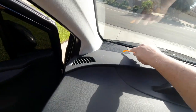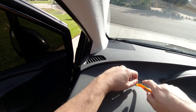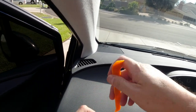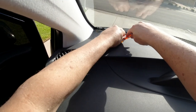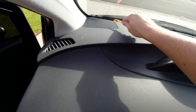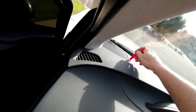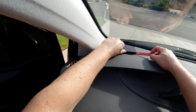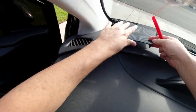The first thing you've got to do is take off this grate. When you see it for the first time, you're going to think there's no way that thing's coming off — I actually did. But I've got the instructions from Crutchfield. You've got to come in here and pry it open, because the two clips are right here and right here, and then this is where it slides up under. Might need to try a couple different tools, but definitely use the plastic ones. You can see that clip right there — there's another one down here, and everything comes out really easy after that.